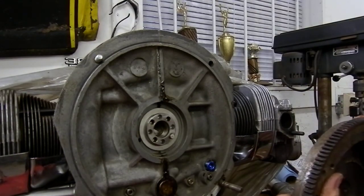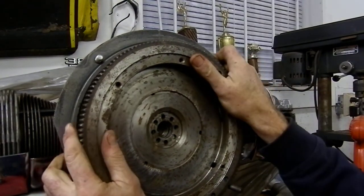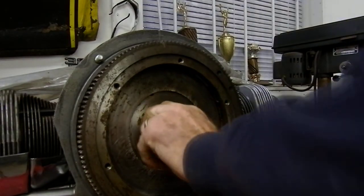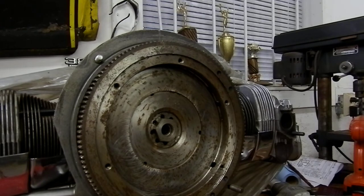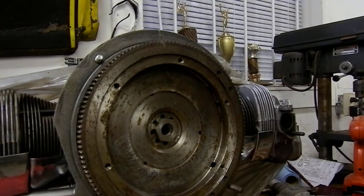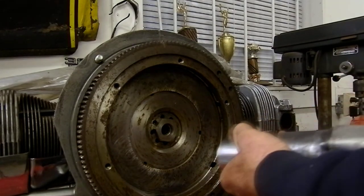Got the three shims in place now. Going to take a look at the index point and the mark I have on the flywheel and reinstall it. Just because this is a VW engine, it doesn't mean these principles aren't applicable to other engines — there may be different ways of controlling end float, either by using a thrust shim or a split shell bearing with a thrust flange on it controlling the end float.